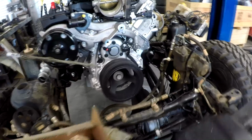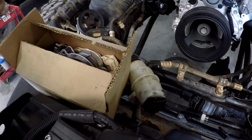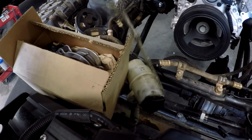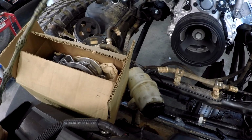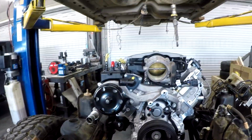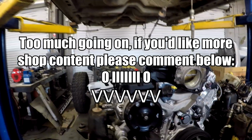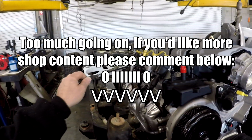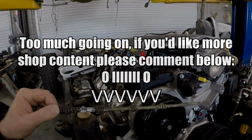And this cap on the stock power steering reservoir actually has a valve in it that mimics the anti-splash valve that PSC offers. So it does seal the system quite well. I'm happy with the way that these work. So we'll see how the steering is when we're done with it, but it's going to be basically the same as it was before. For some of you guys plumbing your LTs, you're going to have 2 vents, one here, one on the other side, and they're going to come forward. They're going to tee into the air intake tube that we supplied you with.